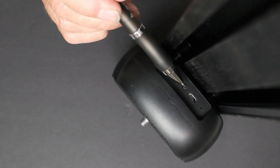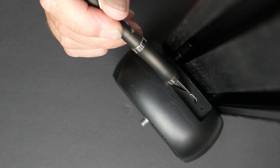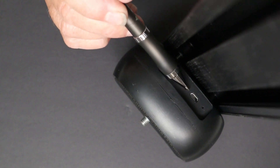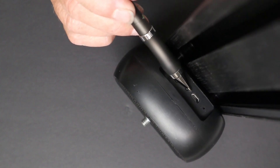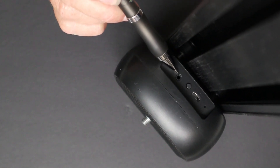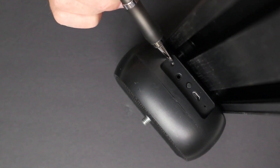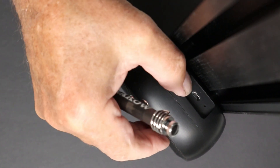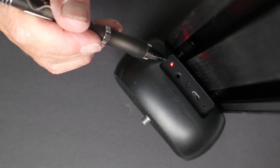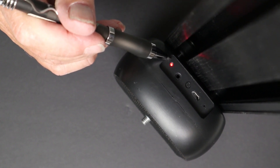On the left-hand side of the slider you can see a reset hole, a micro USB socket for charging — though this probably needs to be updated to USB-C now in compliance with most devices in the European region — a power on/off button, a 2.5mm socket for camera connectivity, and an LED which indicates when the unit is on. Powering on the slider gives a brief flash, then it pulses to indicate you need to connect the app to control it.